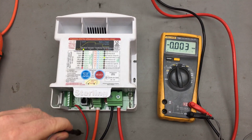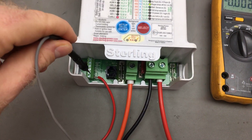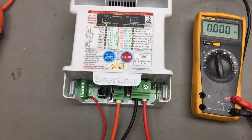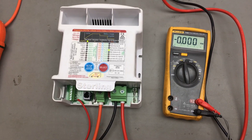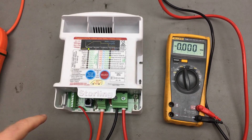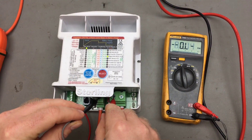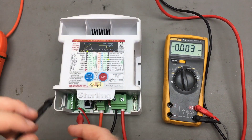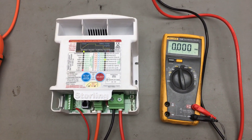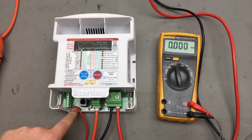This ignition feed cable here is a prerequisite if you're installing it on any commercial vehicle, any recreational vehicle, camper van, whatever, from about 2015-16 onwards. If you don't install this, the input voltage coming in will be too low to naturally activate the battery-to-battery charger, so it will be 15 to 20 minutes of driving before this unit will activate, unless you install one of these.